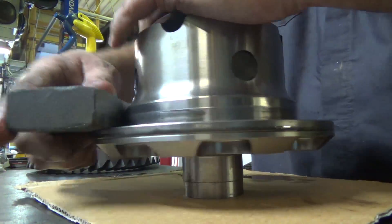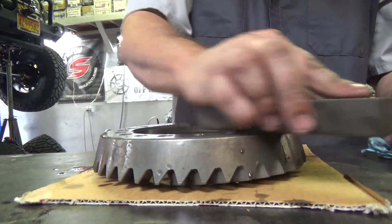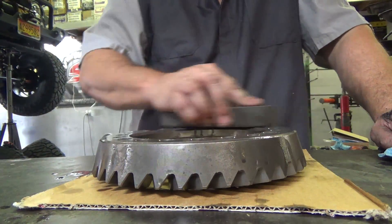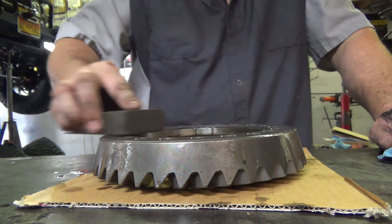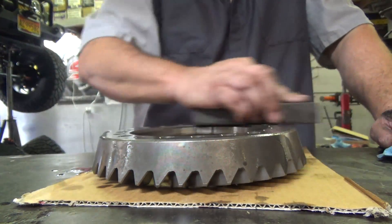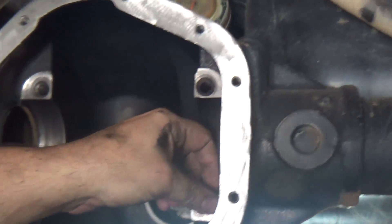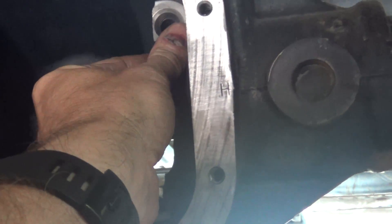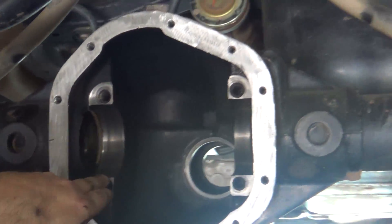The thing about gears is that they're strong but they're brittle, so that's why I'm handling this on a piece of cardboard — I'm not looking to drop this on metal or chip it. If you feel with your finger here there are some really sharp burrs that have overhung here, and here's another one in that corner — real bad. If we ignore those burrs, and there's also a slight mash mark.